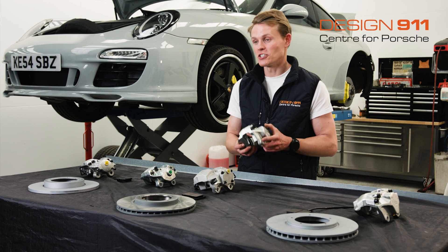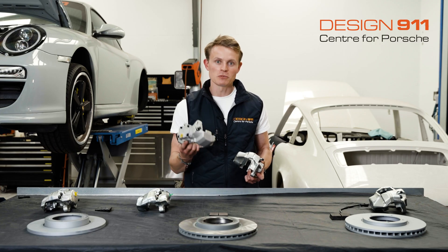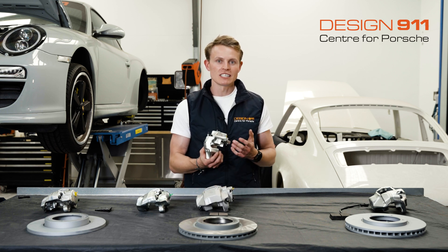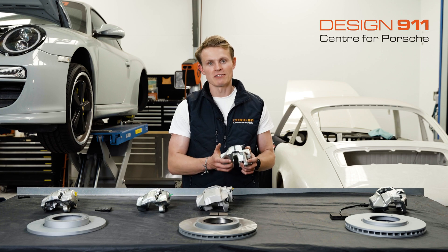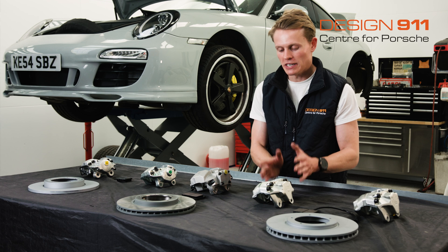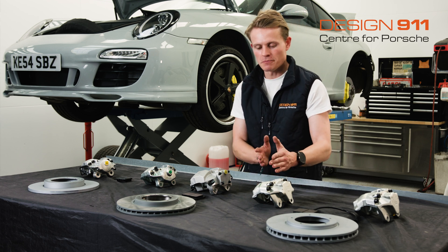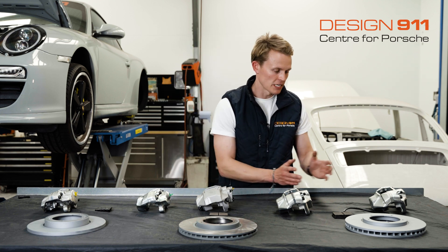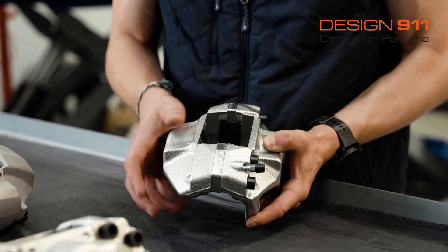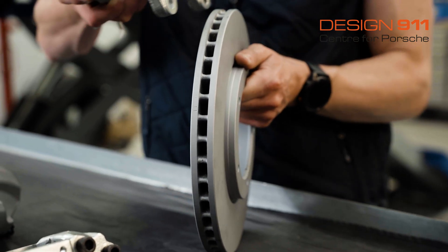The only real significant difference in its design was the material used. Unlike the S-type caliper, which was made from aluminium, the A-type caliper went back to using cast iron and as a result was significantly heavier. The A-type caliper also differed in that it went back to being made from three pieces — two halves and a central spacer. The last change made to the A-type caliper was increasing the spacer by four millimetres, allowing them to use a slightly thicker vented disc on the 3.2 Carrera models.